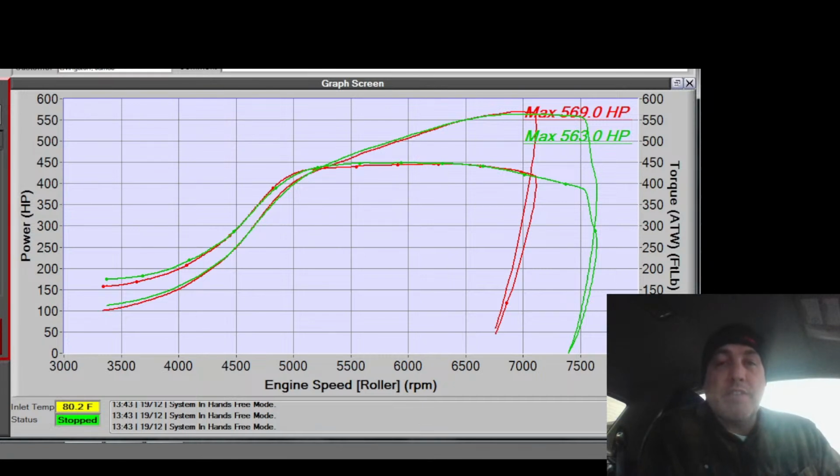Now that's a range. Obviously right now with the really cold weather outside, that's going to drop the speed a bit. I'm going to get like 10% less speed or 15% less speed because it's so cold. But if I try and put myself to the limit right now, when we hit the summer, we're going to be way past the limit. So I'm not going to push this any harder than what is on here right now, because I know we are really close to the limit on this turbo. And in the summer, we're going to be over the limit on this turbo with it right now.